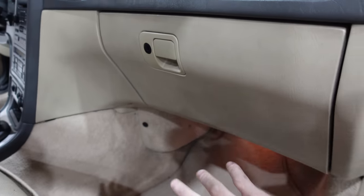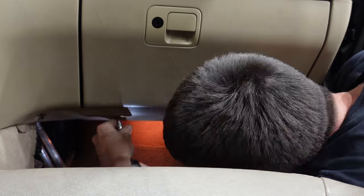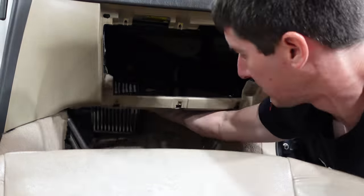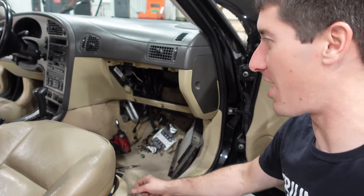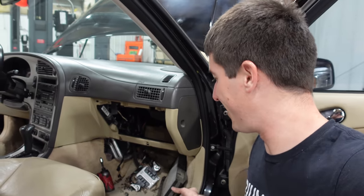Okay, time to fix my mistake. We get to hop back in here and pull everything out from under the dash and change that cabin air filter. This comes out first, then the glove box comes out, and then we should be able to access the panel that's screwed in that has the filter behind all of that - it's all the way at the back. Every other car on the entire planet - 30-second cabin air filter change. Saab 9-5? Nah. The transmission computer right there has to drop. The glove box comes out. The kick panel under the dash comes out. That little hump comes out. And then of course you have to pull like 10 screws to get that cover off.